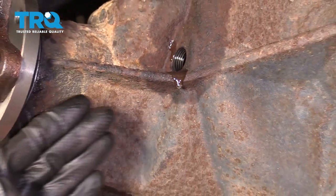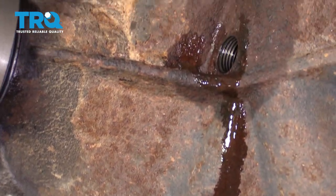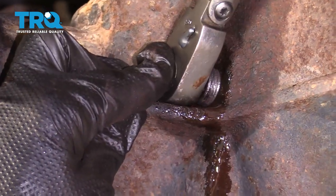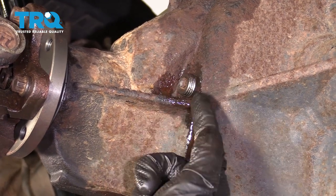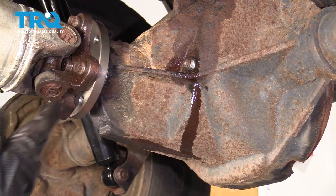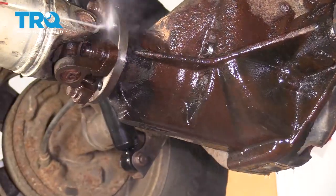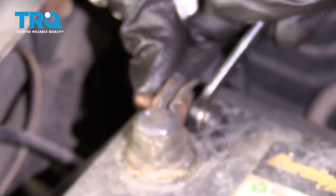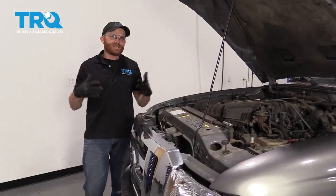Let's let this drain out until it's done. In the meanwhile, let's clean our fill plug. I cleaned up the threaded area on the plug and the magnet as well. Go ahead and put this right in here and bottom it out. The fill plug doesn't go all the way in until you can't see any more threads — if you went in that far, you went entirely too far. Now it's time to clean up all of our mess. Go ahead and clean up the area where we filled the differential and where we sprayed penetrant. Make sure we have clean hands, put it in park, remove the key, and reconnect your negative battery terminal. Double check to make sure it's secure. What's left to do now? Take it for a road test.